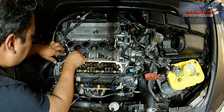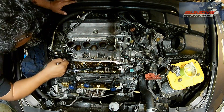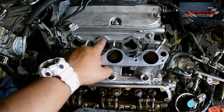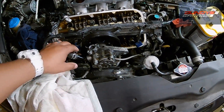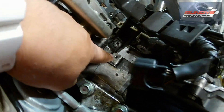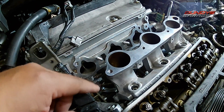I'll put some links in the description below to other Honda V6 DIY videos I've done. I have a lot of videos on this particular engine. I love this engine — this engine is bulletproof. If you take care of this engine she'll take care of you. I'm going to slow things down and show you some tips and tricks on how to take out the lower intake manifold. One of them is out already — the back one, bank one, the one closest to the firewall is bank one, and this one towards the radiator is bank two. One thing you need to do is get the power steering pump out of the way. There's two 12mm bolts that hold it in, and that allows you to get access to a 10mm bolt. The reason you want to get this out of the way is it kind of blocks a couple of bolts.